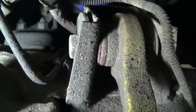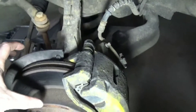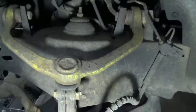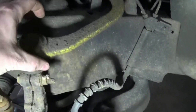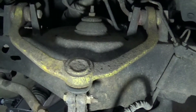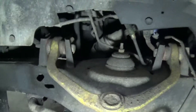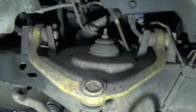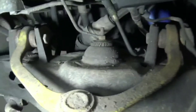You have to turn them evenly, because if you turn this one more than the other one, it's going to throw your alignment off — it's going to pull your wheel in or out. If you turn them the same, it's going to push this control arm either in or out. On this truck I actually have some positive camber in it, just because it makes it look cool. But if you have too much positive camber, it'll wear your tires down. I always rotate these tires, so I live the camber life — positive camber. I'm all positive in my life.